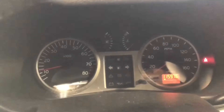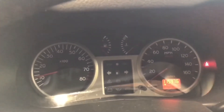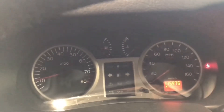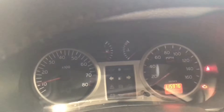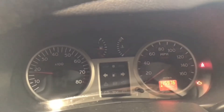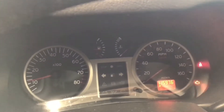Let me just start the car to show you the symptoms. There's the car idling — you can see the engine management light in the bottom right-hand corner flashing away. The car just sounds like it's missing, and when I flick the accelerator it sounds quite rough and coarse.